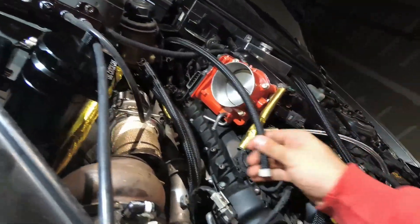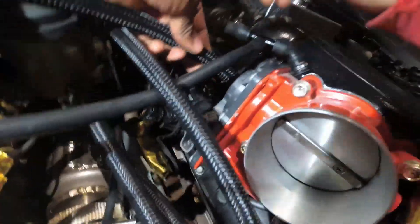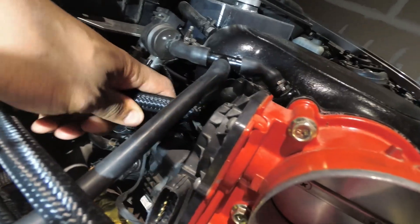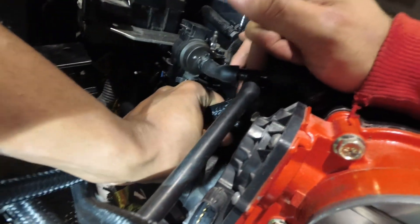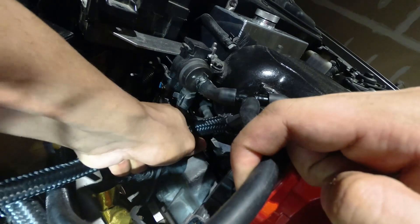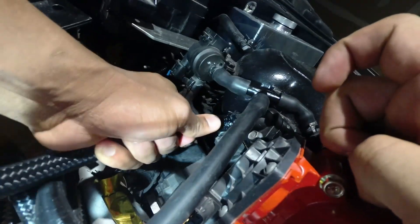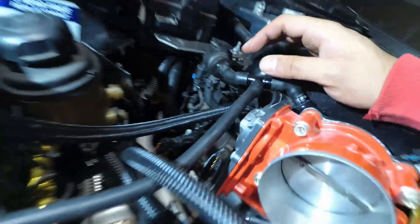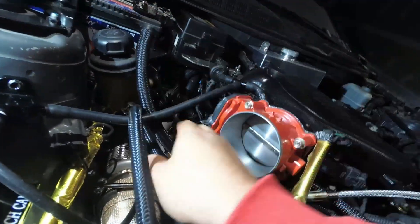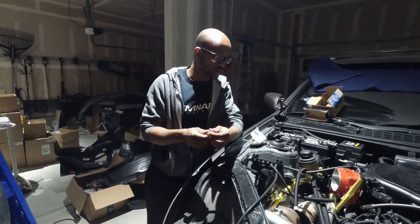The outlet is a lot simpler since it's much shorter. It goes from the outlet of your can to the original PCV hose — just squeeze the hose in and then clamp it again just like the inlet. It's going to be a tight fit so don't be discouraged; it should fit perfectly fine. Zip tie it all the way up, run it around, and it goes to the outlet.